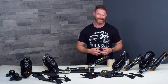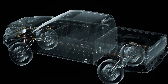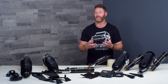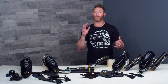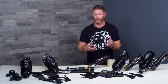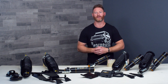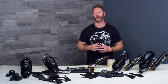If you're not familiar with what damping means: inside the shock body there's valving that controls the speed at which the shock moves through its compression and rebound cycles. A firm compression damping setting is going to make the vehicle feel more stiff and firm, less responsive to small inputs in the road, but when it encounters a large hit it's going to absorb that without the shock bottoming out. On the other end of the spectrum, a soft compression damping setting is going to be more responsive to the trail and more supple in rock crawling situations, but if it encounters a large hit it's going to be more likely to blow through the stroke of the shock and bottom out.